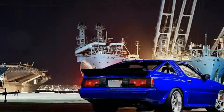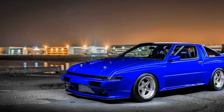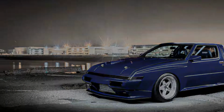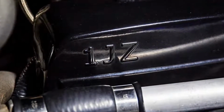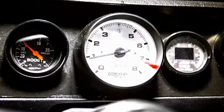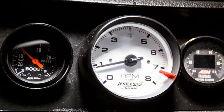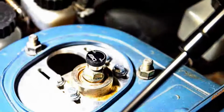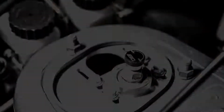He also ditched the piggyback in favor of an AEM V2 ECU. The transmission would eventually give way when a thrust washer broke during drag racing. He was making about 650 HP when he stripped third gear. The 5-speed was chucked in favor of a 6-speed manual from a Nissan 350Z. That, with a 6-puck South Bend clutch, was enough to hold the power he was making.